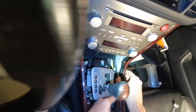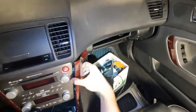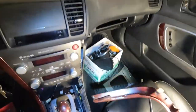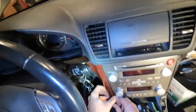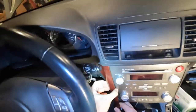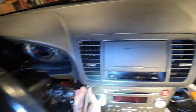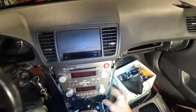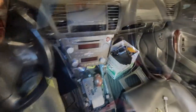The center trim panels are going to come off — these all have tons of tiny yellow clips. It just kind of slides to the side, gently, gently, gently — all the clips intact. Beautiful. Go to the side gently, a little bit of wiggle. Next up, these two Phillips screws up top. With the upper Phillips out, that will enable this panel to come off.